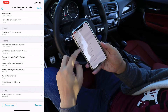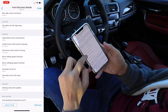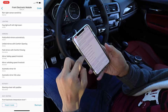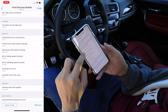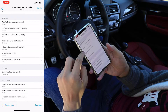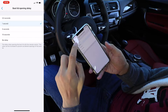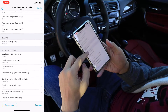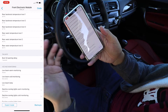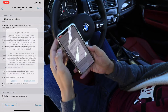Another one you want to do is the mirrors — the fold and unfold automatically. That's active. Unfold — comfort opening — that's already active. Hold closing — that's not active. It changes automatically when I click in. I want to increase this a little bit, maybe one second. What I increased there was the boot lid opening delay — pressing and holding the button for one second as opposed to 0.5 seconds. Might make a difference. Let's try coding this for now and see what happens.